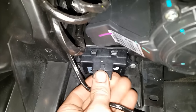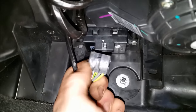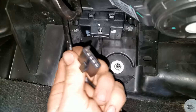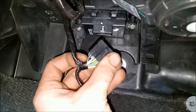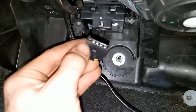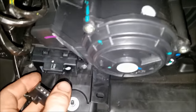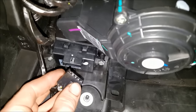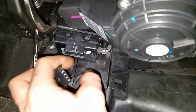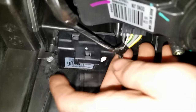I'll put a link in the description if you need a fan. So then I came over to the blower resistor right here, pulled down on this and squeezed this tab off — it was pretty tough getting off — and boom, we have a melted connector there. This black wire coming in is your main ground. A lot of electricity flowing through there, a lot of electrons. These connectors are just really too small for how much current this thing draws. So we're going to need a pigtail, and we're also going to replace the resistor because it gets melted up inside there too. It's going to be the same 5.5mm or 7/32 bolt to get that off.